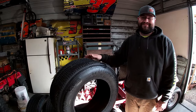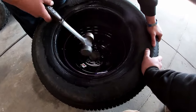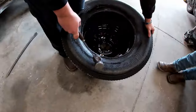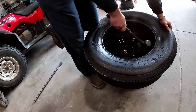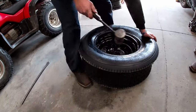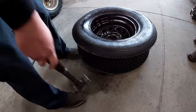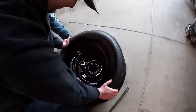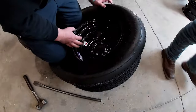I always put my knee up here, just in case I miss, I just hit my knee. I'm finna get up out of the way. First things first, you always gonna hit it in that area, in the first side zone. You put your knee down here like this, so your bead's down here.